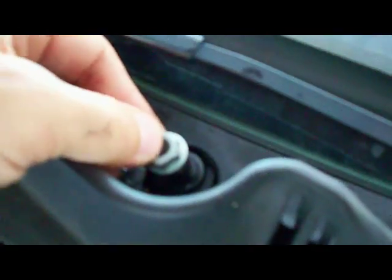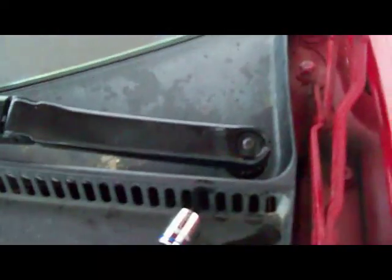Just pop off your nut, which will look like this. It'll be one of these little guys, sitting on there like that. Just use a small flathead screwdriver, pop this off, get it off to the side. You'll have to undo that nut. It'll end up being a — I think it's a 13, 13 millimeter.